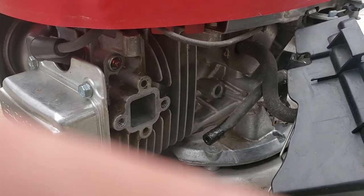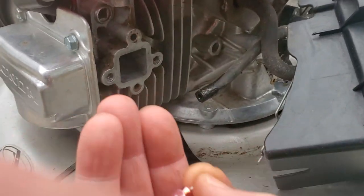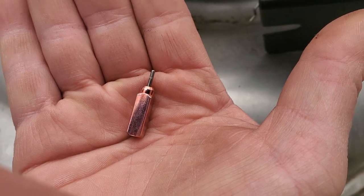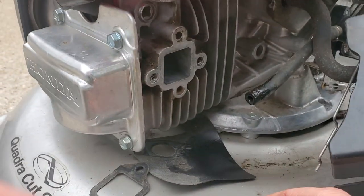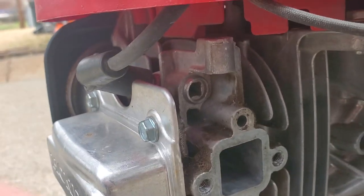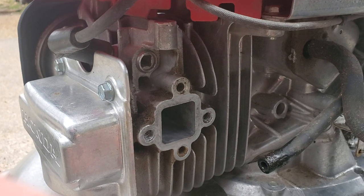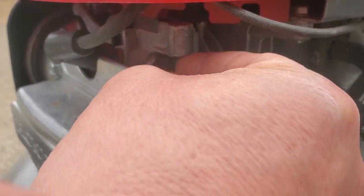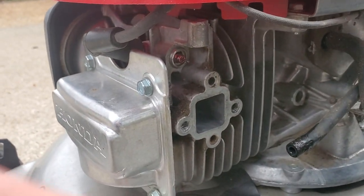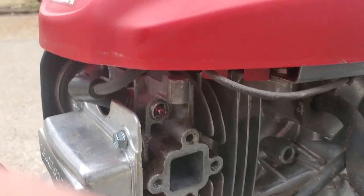In a cold situation when the engine is cold, the choke valve will be closed in the carburetor. I'm just going to take this right out and show it to you - that's what this looks like and that little pin comes out. I noticed when I ordered that from Amazon that I didn't even have one in there, so restarting this thing was really hard. Now it works really great. If your mower is not restarting after you've been using it a little while and it's warm and won't restart, that's usually going to be the problem.